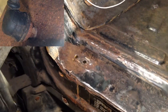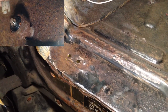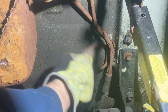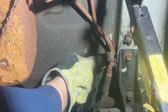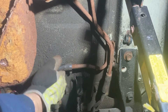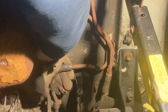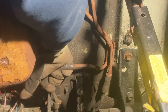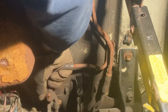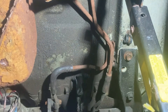While you're under there, remember to unplug the vacuum tank sensor wire as well. Next we need to disconnect the vacuum lines — there are two, and there's also one bolt holding them in place. There are no clamps holding the hoses in place so you just have to pull hard and they will pop off. Be careful as the steel lines can bend and kink. If they do kink you can straighten them back out again, but maybe take that bolt out first.